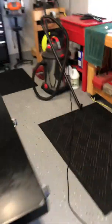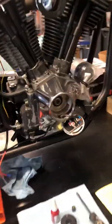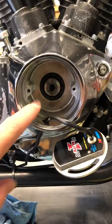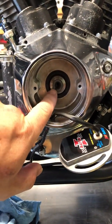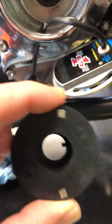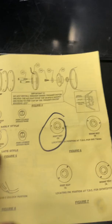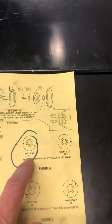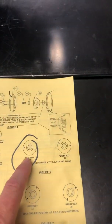If we go around to the other side here, you can see the cam chest cone. If you look in here, you'll see this has got a little slot on it where the rotor fits in to make sure it's in the proper position. Looking at the instructions here — front cylinder top dead center mark on the flywheel and the correct location of that pin.